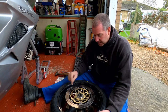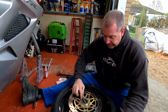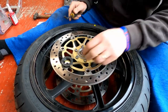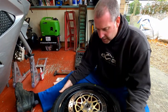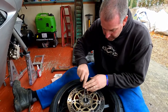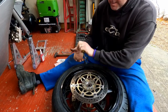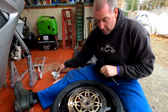To start, what we need to do is get the dust seals out. That's simply done with a screwdriver or a pry bar — just like so. Pop that to one side, pop that to one side, flip her over and we'll do the same on the other side. That's the two dust seals removed and they're scrap because we've got brand new ones.